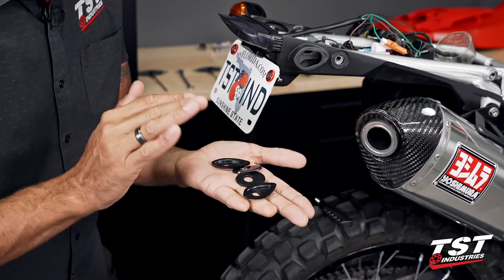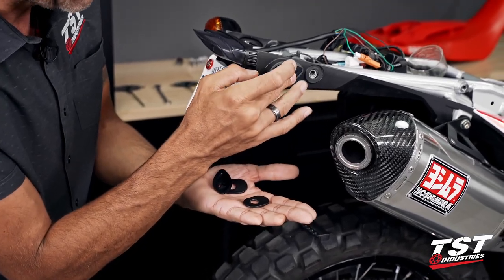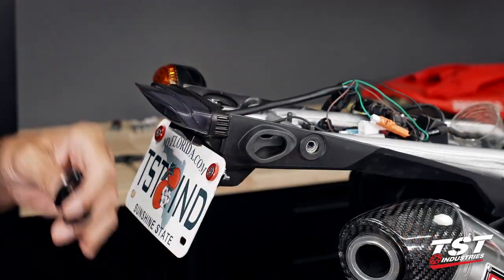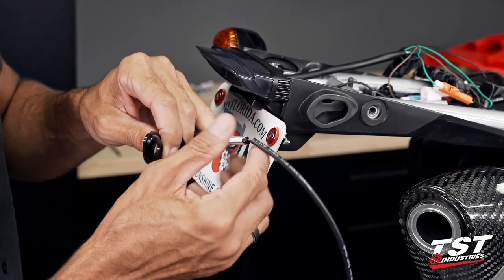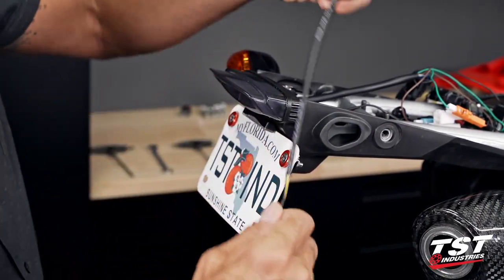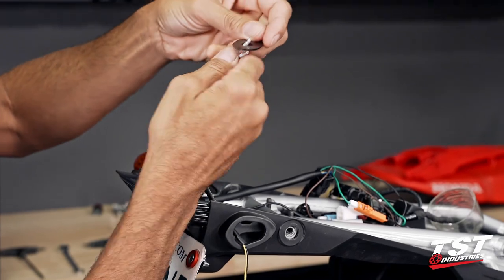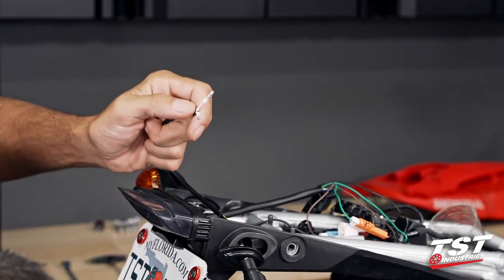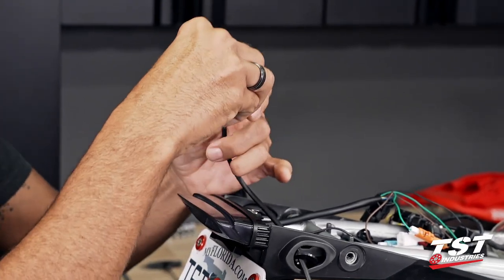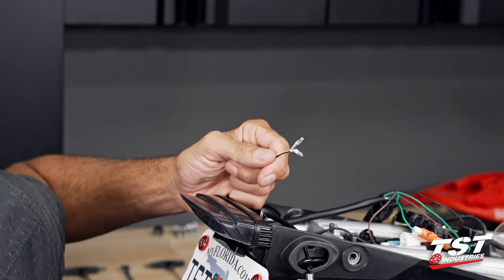So essentially we are using only four of the parts, two on each side. The teardrop adapter goes on the outside against the bodywork, and then we have this ovalized component that goes on the inside. I've already taken off the washers and the nut off the stud here, so I'm gonna feed my wiring through the teardrop adapter, get this through the bodywork, get our ovalized guy on, and then the split washer that came off this signal just a couple steps before, flat washer, and the nut.